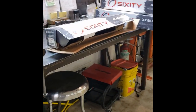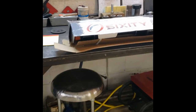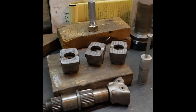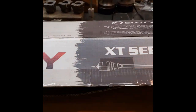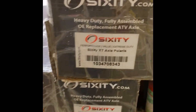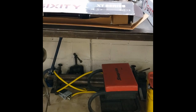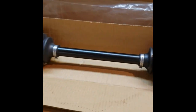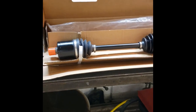Talking about the axles — I showed in the first part of the video how I cut the factory axle up and made these adapters, with the stub sticking out of the end. I use Polaris axles — I buy them on eBay. There's the part number. This axle only fits one or two buggies; it's not one of the more universal axles. It was chosen for its length and availability of parts on the hubs.